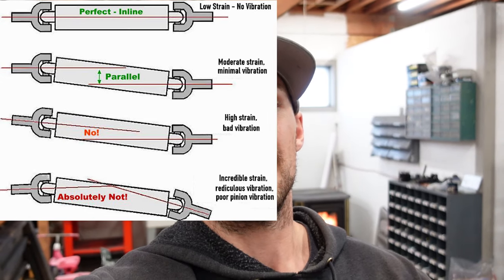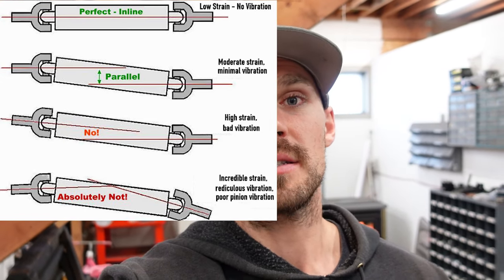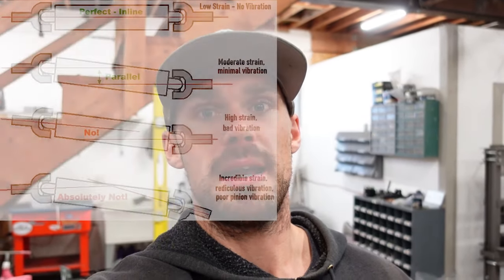For a single shaft like this — what's on the Hilux — with a single joint on each end, you basically want the axle and the transmission horizontal. One's going to be higher or lower, but you want the u-joint angles to be the same on both the transmission and the axle. So the output of the transmission and the axle are on the same horizontal plane. This truck is going to be super simple to set up, especially because I did a three-link on it and all the arms are adjustable.